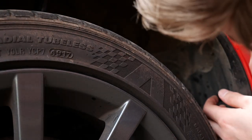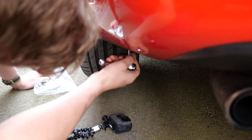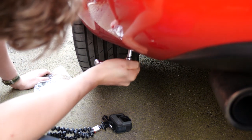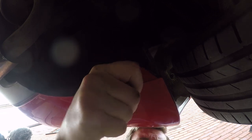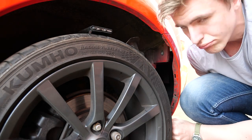With a job like this, with so many different sized screws, I like to bag everything up and label it. The last screw on the rear wheel arch liner is actually underneath the bumper. There's a bolt and a nut holding the two pieces of plastic together but over time the rust has basically bonded them together, and the only thing holding it is a thin piece of plastic, so the first thing to break is that little plastic housing inside the nut. The bolt and nut assembly is just spinning freely inside the plastic housing. I then realised I didn't need to take it off — you can already access the rear bumper screws, so you really don't need to take the screw and nut assembly out.